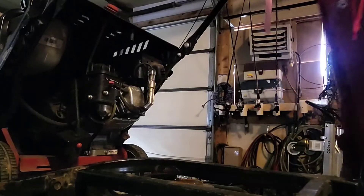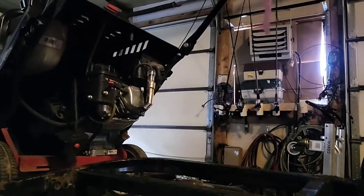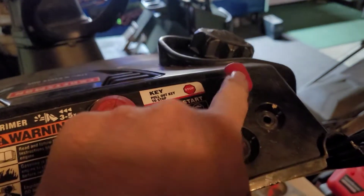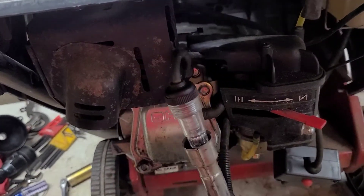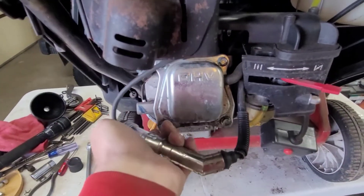Let's see if we got spark. Doesn't look like it. Sometimes these things right here go bad — it's just a two-wire connection that goes bad. We're not going to assume the coil is bad just yet. I tried it off-camera on one of my lawn mowers that I knew had spark, so it's not my five-dollar Harbor Freight tester — good thing.